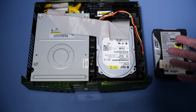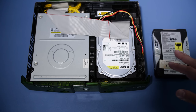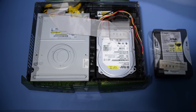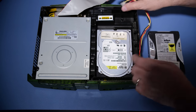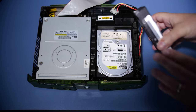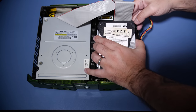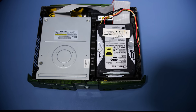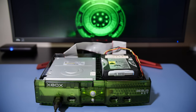On a retail Xbox you can't do this unless you unlock your drive, but on a debug kit it should allow me to just swap these out and access the contents. We pop out the drive, disconnect the power cable, and sit the new drive on top. We connect it, plug in the power cable, and go ahead and turn this on to see if it actually boots up.